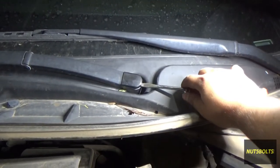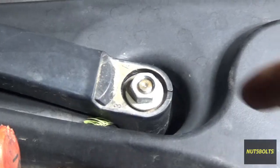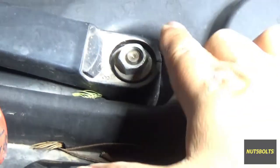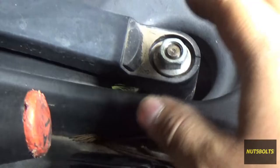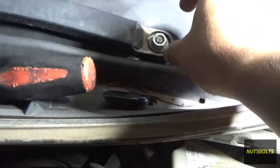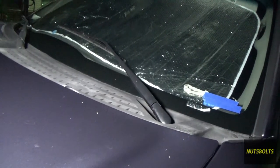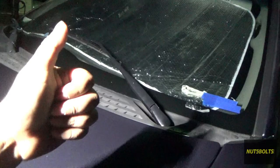Now let down the wiper arm slowly and you're good to go. This is what I was talking about on another car — some have bolts on there. If you take off that cap you'll see it's got a stud and nut, and the nut pushes down against the splines which are tapered. Sometimes even with those, if it's very corroded you might need a puller to get it out. But in my case with my truck it was pretty easy — it just had that little lock. So there you go guys, another simple fix done on the truck. I hope this helped you out, and remember to like, comment, share, subscribe and all those other goodies. Thank you.